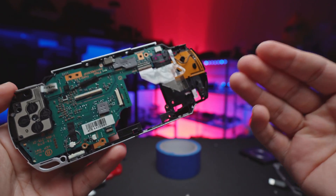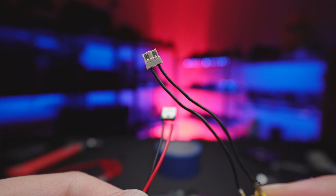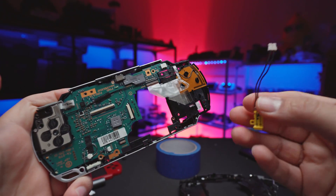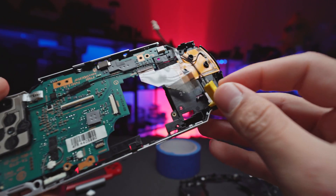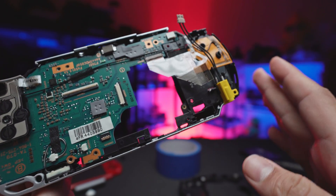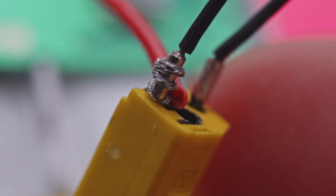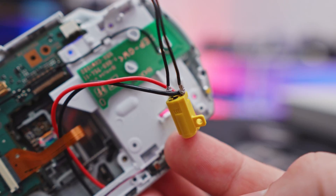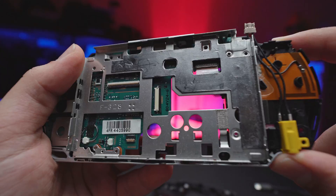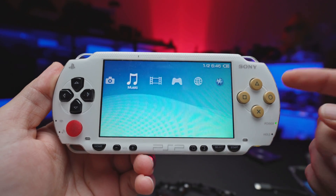If doing this solderless, remove the insulation and cut it as close as possible to the bottom, since the stock charging port will have thinner wires which will be very necessary. My preferred method if you are soldering is to keep the original charging port exactly where it is, solder two small wires onto the contact points, and wrap them around the same area — that way you keep the original function in case you want to use an original accessory like a speaker. However, the wires on the pre-soldered port are just way too thick, which ends up pushing the subframe, resulting in a terrible feeling square button as well as unnecessary stress on the display.